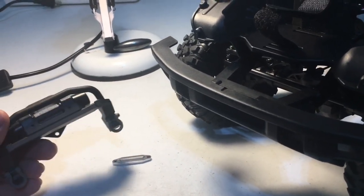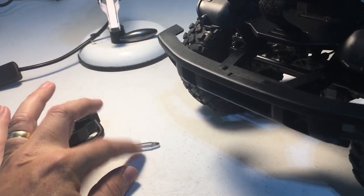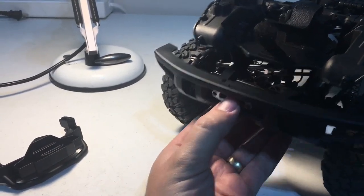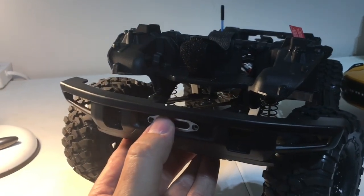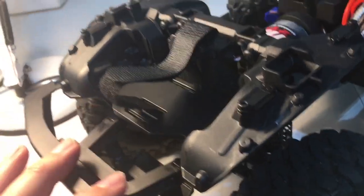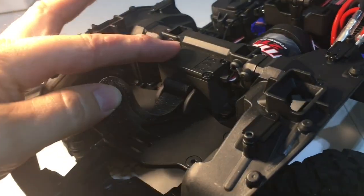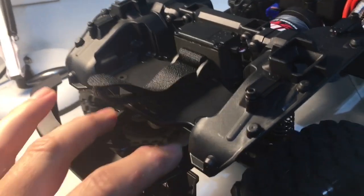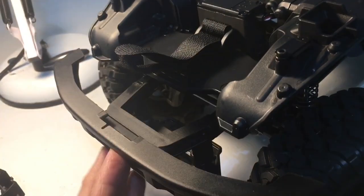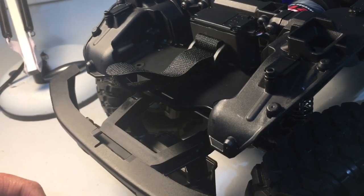This is the winch portion that I pulled off the front. I pulled the fair lead off. It is plastic, but it's chromed plastic, and it seems like you could easily mount that right here, cut a slit in that bumper, and mount a servo winch right here. Here is a size comparison of the front bumper hole to the original servo. I set a dummy servo in here and one fits, and the spool is right in line with that slit right there.